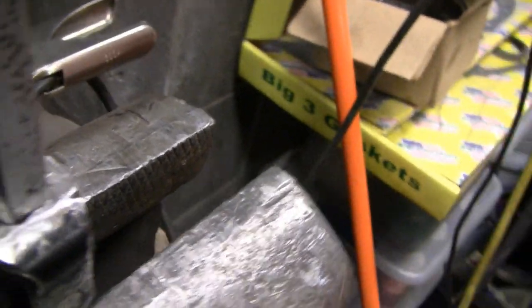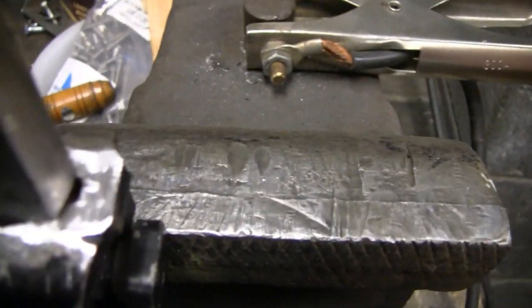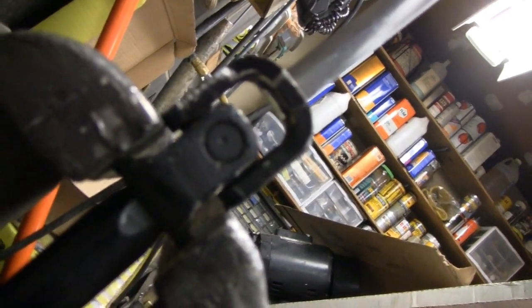I cut that D shaft so it fits into the old grooves there. See where there's a little bit of space on the sides - that way we can get down into it. And I've got it sticking out the bottom so we can weld that.